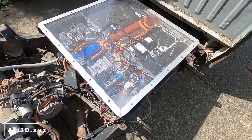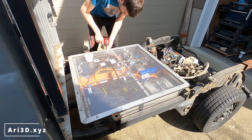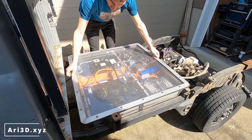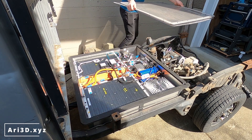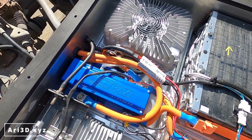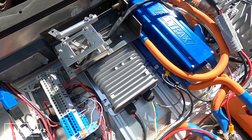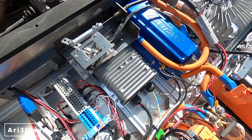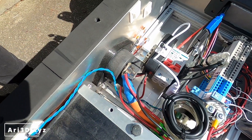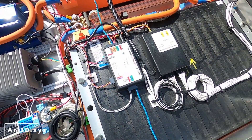Further forward we've got this box under a waterproof lid that has the rest of the electronics in it. Taking a look inside, on this end we've got the charger, DC motor controller, the throttle box, and a 12-volt DC to DC converter. I opted to not have a 12-volt battery at all — everything's powered off the DC to DC. Over here we've got a contactor for the heater inside, a USB to CAN adapter, and the master power switch which is accessible from the outside so that's easy to turn off if there's ever any issues.